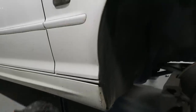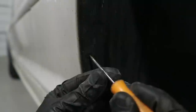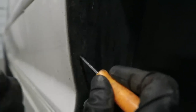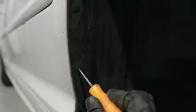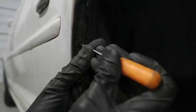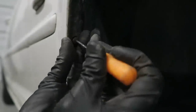Now let's go ahead and remove the fender liner. Basically what you do is take a pick or anything like that and just push the center section in — it's gonna fall out usually like this. Usually they fall and just get caught in the fender, and when you take the fender off they'll all fall out, so just make sure to watch for those. Then once you have that, do the other one — just pull it out with the pick or a flathead, just like that, and that's how they look.